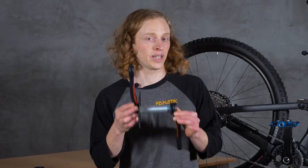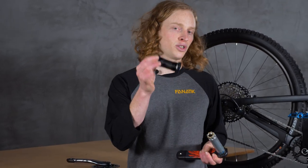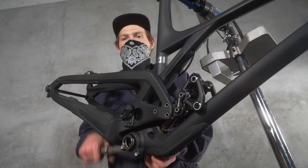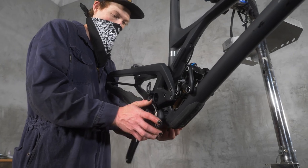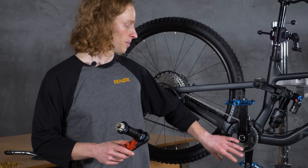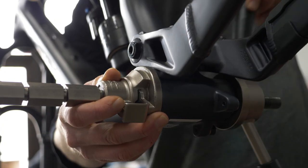To connect all this to your frame, you need one crucial piece called the bottom bracket. This is simply two bearings, much like your headset, through which the crank spindle goes. Many of them these days are threaded, like the one I have here, or — as on our example frame over here — press-fit, which means that we use a press to squeeze it into the bottom bracket shell.